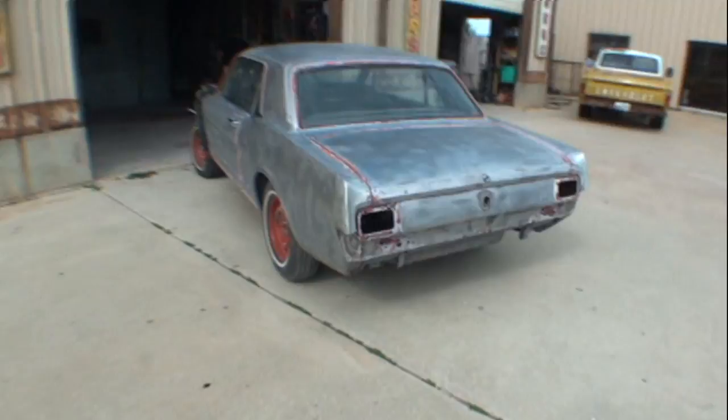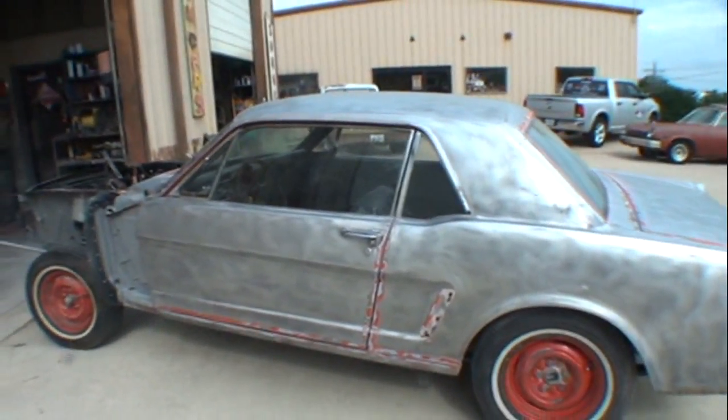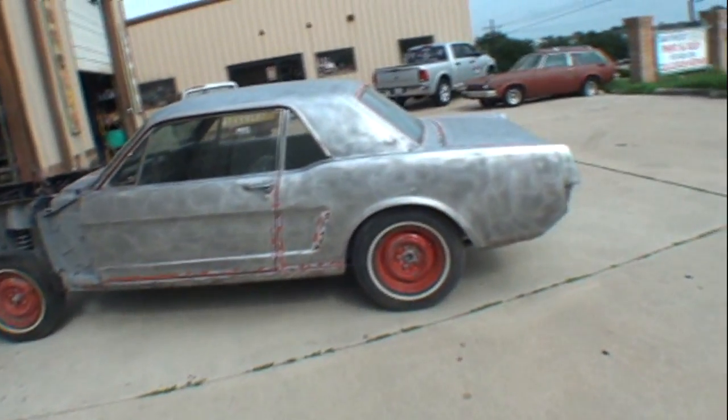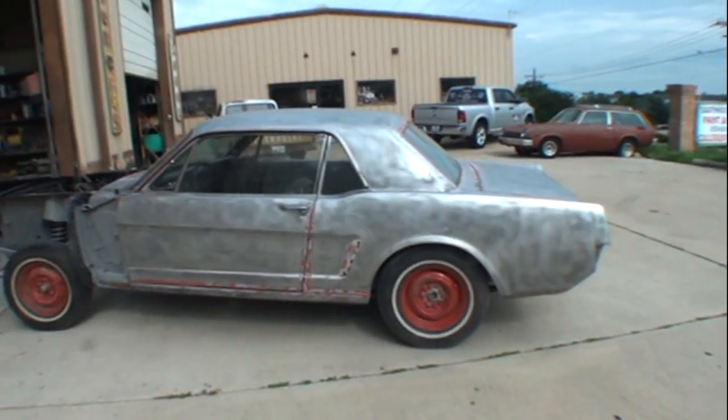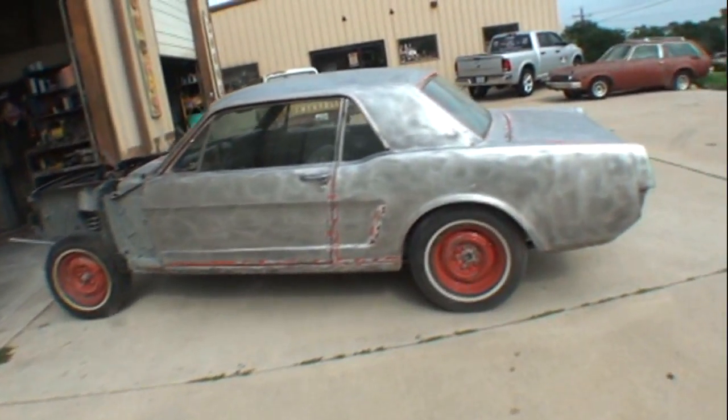This is the next day and we finally got our car prepped and ready to paint. Let's look at the difference between soda blasting and sandblasting and what it takes to get the car ready for epoxy primer. You can see everything is prepped — I used my DA sander with 80 grit and completely detailed it out, vigorously changing the sandpaper whenever it got dull.